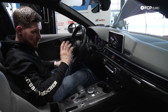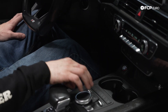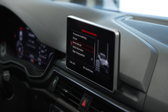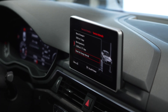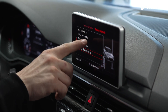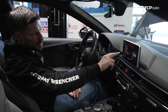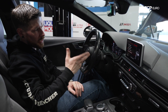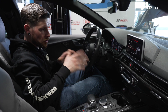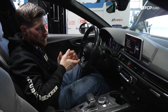While you've got the vehicle warming up and setting the oil level, get into the main menu here. From the vehicle menu, hit the button off to the side, go down to service and checks at the very bottom. Get into service intervals and there'll be a reset oil change interval there — select that. Oil interval has been reset. You will notice that only resets the oil service at the top of the screen. The inspection at the bottom that reads 12,900 miles or 371 days has to be reset with the scan tool — that is basically doing a full inspection on the car, checking the brakes, tires, and inspecting the vehicle for any possible service. If you don't have the ability to do this, you may have to find a dealership local to you or a shop that has a scan tool available to reset this.